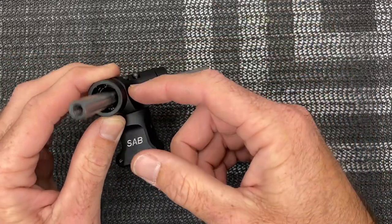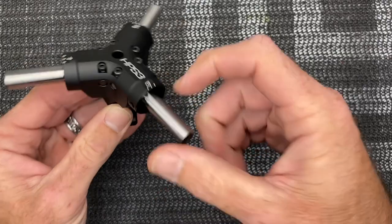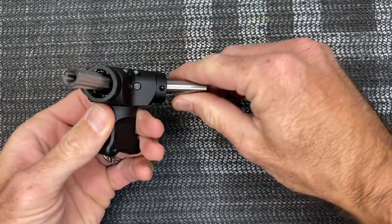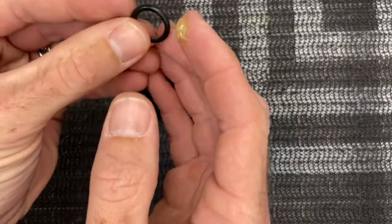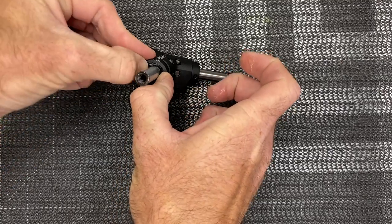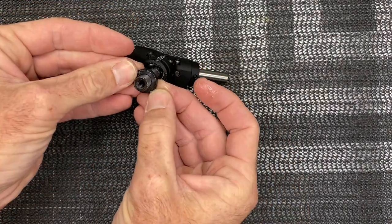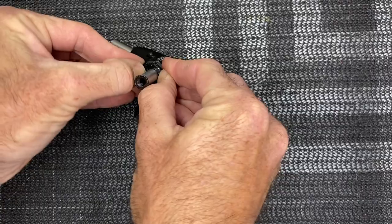They already came with micro lube inside — pre-installed. This is a pin that goes through with a flat spot, and your feathering shaft has a hole that the pin rides through. Two set screws lock this pin into place on the flat spot, and your feathering shaft can move. First, grab a little bit of micro lube on your finger, grab your O-rings, get the O-ring lubed up, and slide it down into here — push that O-ring down. Grab the head dampener — ridged side and flat side out. Be careful not to get any grease or micro lube in the shaft.